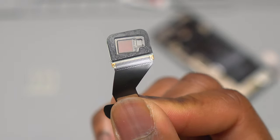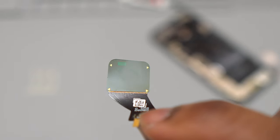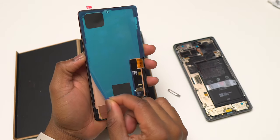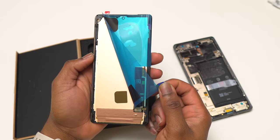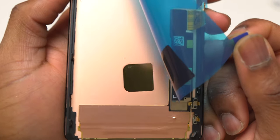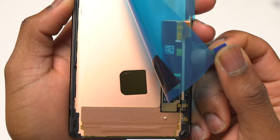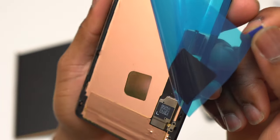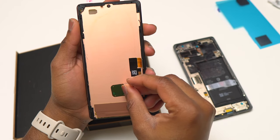The small square in the middle of the fingerprint sensor is made of glass — if you pull it the wrong way it can crack and you'll lose your fingerprint sensor. Now it's time to install the new screen, but first inspect it. I noticed a small stain on the fingerprint sensor area that looks like double-sided tape — this screen may have been used for testing before being sent to me. I will not be cleaning it, and will just install the fingerprint sensor to avoid anything else getting into that area.